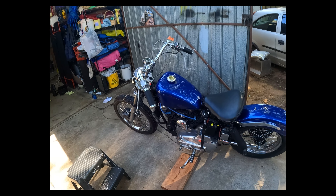When I put it on the jack stand you can probably see the wires underneath. I haven't got my soldering iron - it's in my work car so I'll get that back Tuesday. I'll be able to solder that and put proper connectors in. Also on the back of the starter relay one of those cheap crimp connectors snapped off, so I've basically just clamped the wire between two washers just to get it started. I am going to do it properly.